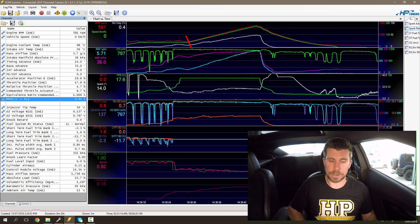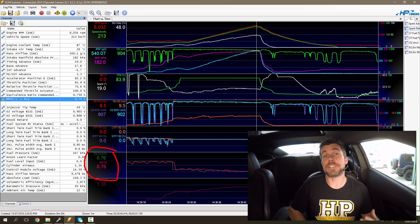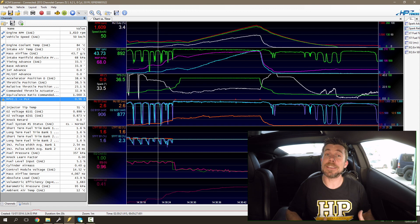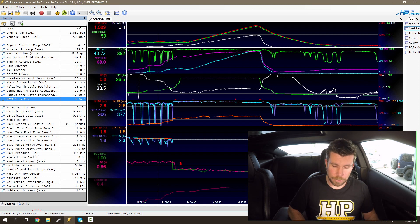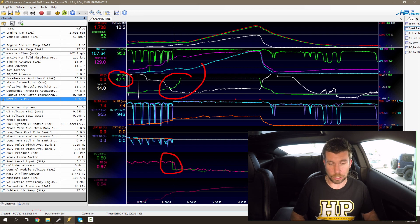Let's jump into our VCM scanner software to see this in a little more detail. At the top we can see our run, starting at around 1,500 RPM and going through to 6,000 RPM. What we're interested in for this lesson is our equivalence ratio commanded versus our measured lambda. Our green value is our commanded lambda value. At the start of the run before we go to full throttle, our commanded lambda is sitting at 1.0, and our short term and long term fuel trims are still active — meaning the ECU is still operating in closed loop. We haven't gone to a high enough throttle setting to move into power enrichment. At this particular point, our commanded lambda drops to 0.80 — this is when the ECU moves into power enrichment, corresponding to when I've started to move the throttle wide open. We actually transition into power enrichment at 47% throttle opening at 1,700 RPM.